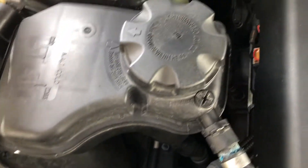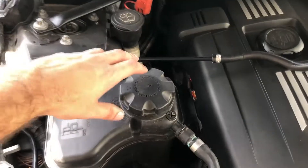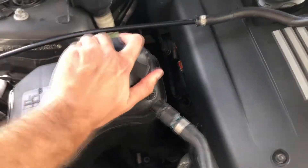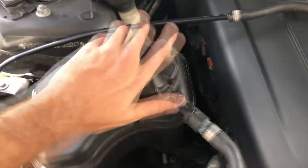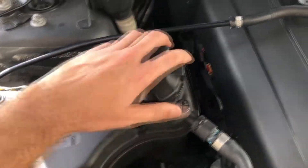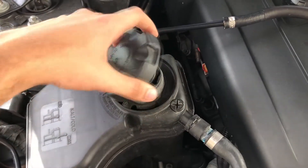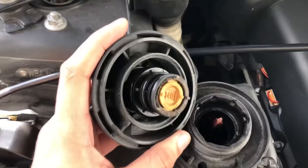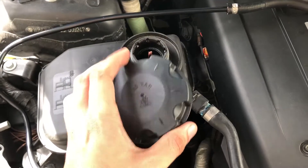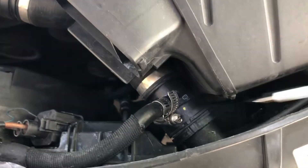The new one has what seems like a more sturdy plastic, so I think this will be better and will last longer. First thing you're going to do is take off your cooling cap slowly — you want to do this on a dead cold car, because if your car is hot you're going to throw coolant all over the engine bay. I'm also replacing this cap because it's complete junk and already falling apart, so before it leaves me stranded — here is a new cap right here.